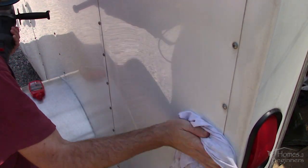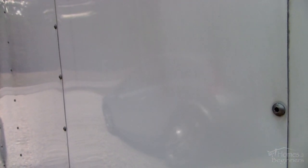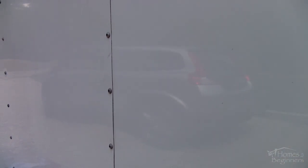Then follow up with a soft cloth to remove any leftover polish. Here's a couple before and after comparisons between the newly polished surface and the existing paint. The size of the area you work with will depend on your weather conditions along with what you're comfortable with. Try not to work in direct sunlight as this can dry the polish, making it harder to work with. While it is harder to see here on white, there is still a noticeable difference in the surface clarity.